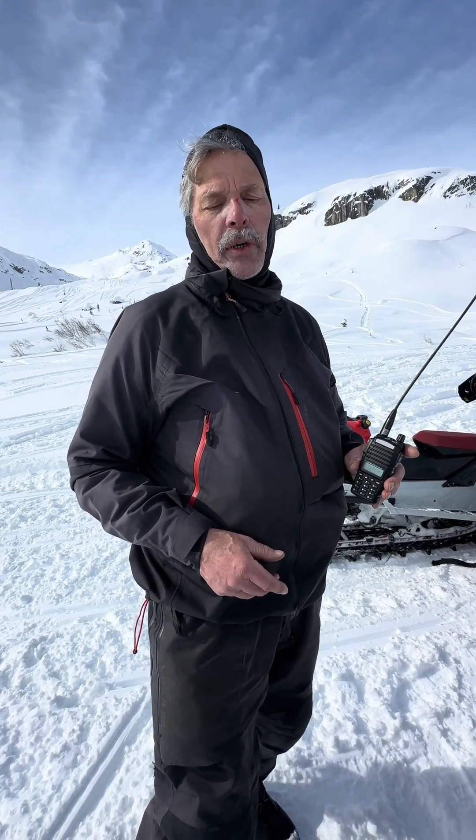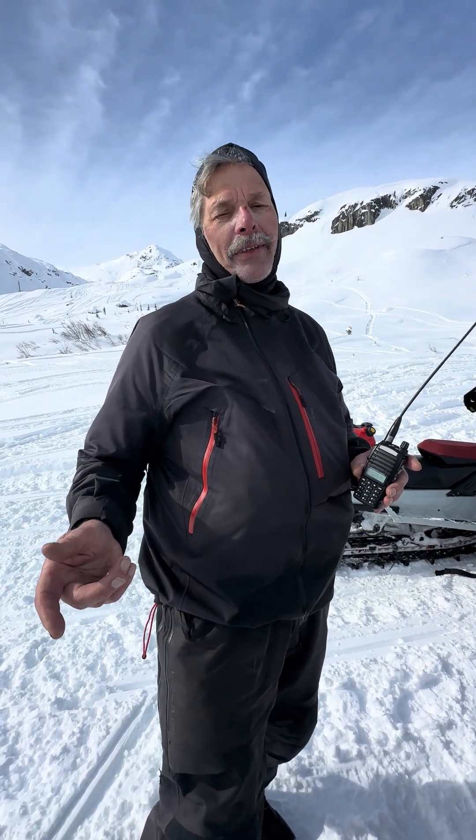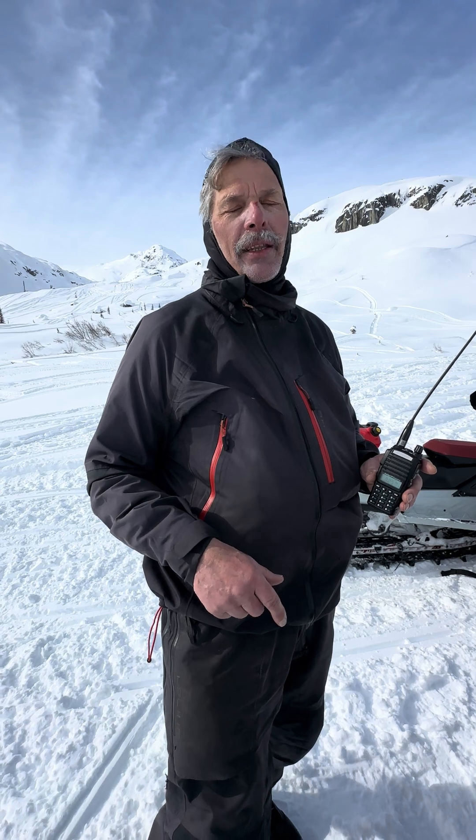We were out a couple of days ago and I was wondering why I couldn't hear my buddies. I had turned my Squelch up to five and I was using my radio at the house and I was getting a lot of interference from lights and stuff like that. So I finally figured it out, pulled the radio out, turned it to one, and I could hear him again.